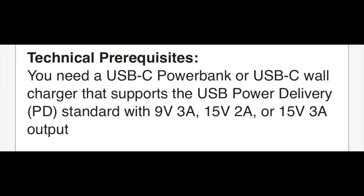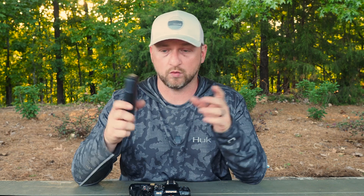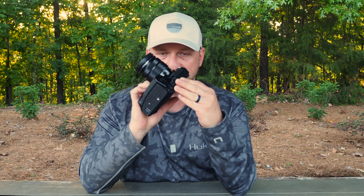When looking through the power supply needs for the camera, what was repeatedly outlined is that the PD output — the power delivery from the USB-C — needed to accommodate 9 volts at 3 amps. That was the standard, and this battery does it. I'll have links to a lot of this stuff in the description below. So the USB-C works just fine for that power input. I tested it and everything seems to work just fine with the USB-C, so I started thinking through the problem I was having and that's when I came to the power grip. The workaround is this DC 9-volt input area right here on the side, which is designed to take the Olympus AC adapter so you can use this for long-term periods of shooting plugged into wall power.